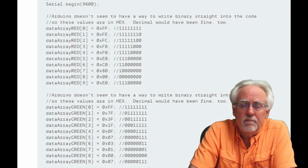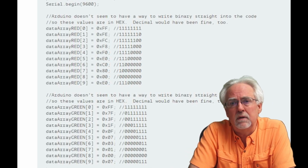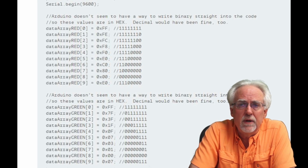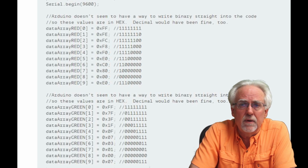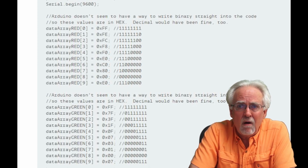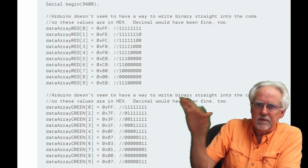And so the way you would program the computer would be something like this, let's say you had 4 bits to be easy. Let's put the number 0010 in memory location 0000. And then let's put the number 0011 in memory location 0001. And then let's have a command at memory location 0011, and that command is going to be load memory location 0000. So you see, all the commands, all the data, and all the addresses were zeros and ones. And in fact, you kind of had a keypad where you were just sitting there putting in zeros and ones.